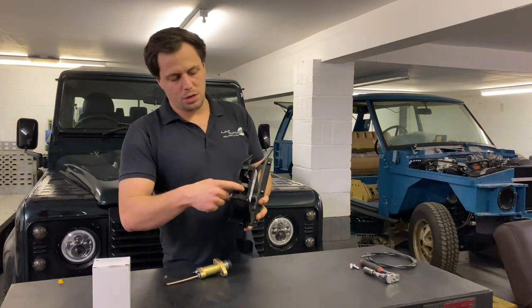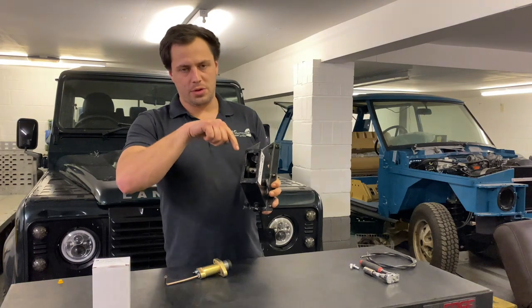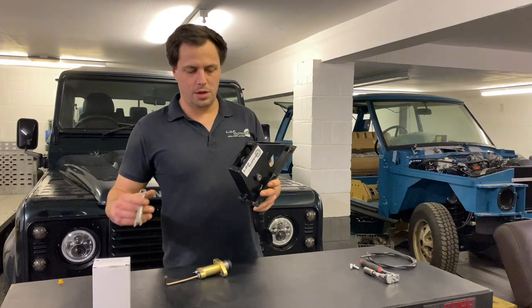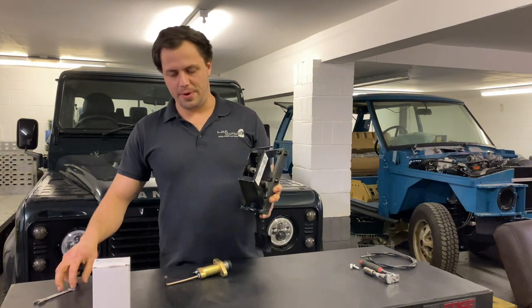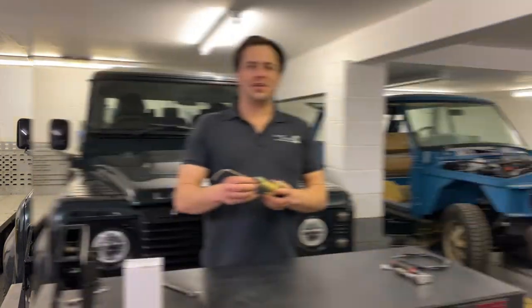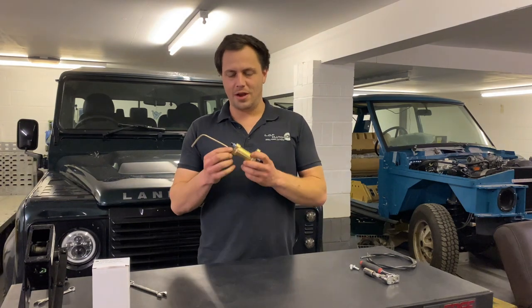On the Defender, if you'd like to raise the pedal height at all, you can do so with the lock nuts on the master cylinder. This is located on the bulkhead in the engine bay — you can move the pedal height by winding it back towards the radiator using the two 13 millimeter lock nuts. You can see the Power Master video on how to do that. And that's pretty much it — that's our video on how to fit the LOF Power Slave. If you've got any questions feel free to send us an email, and if you're happy with our service and the product feel free to like, share and subscribe.